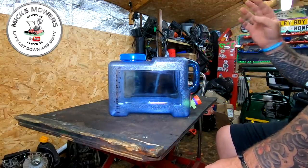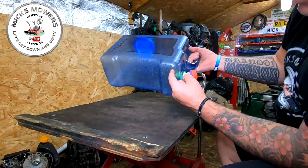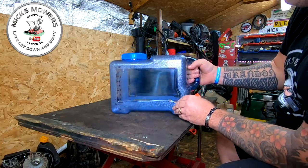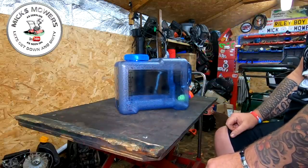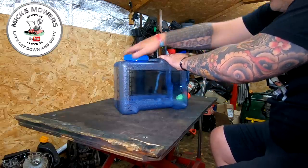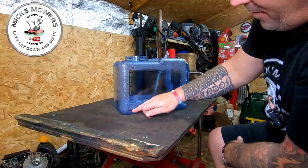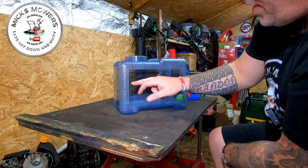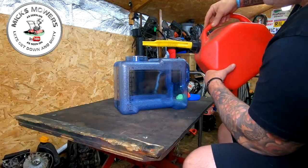What you could also do is put a very small hole in the bottom of the container and fit a little rubber bung with a fuel tap — that would work absolutely brilliantly. I've got my container with a tap, done up nice and tight — no leakages. I've marked it from half a litre up to 10 litres, with the halves and quarters in between, all measured out using water.